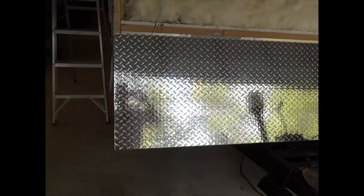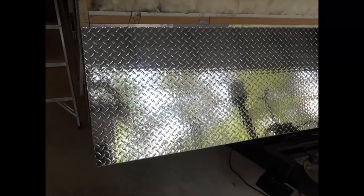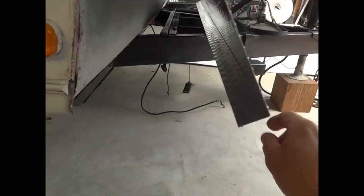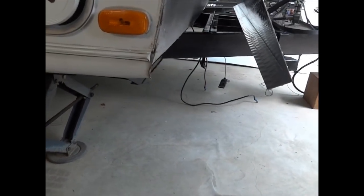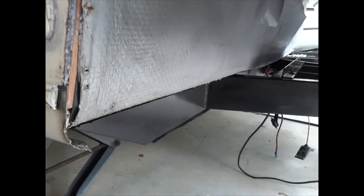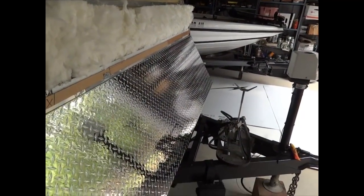Over here on the trailer we have the bottom piece, which is approximately two feet of aluminum diamond plate, 0.063 inches. Had to buy a four by ten sheet of this and have it cut to size, then bent with a 90-degree break on the bottom. That two-inch flange will bend underneath the lead edge of the bottom of the trailer to keep water out. Of course it's already waterproofed underneath there with the undercoating the trailer manufacturer provided. We will start dry fitting these pieces to make sure they all fit.